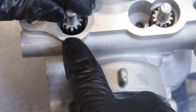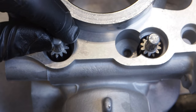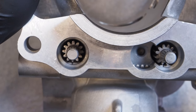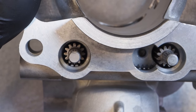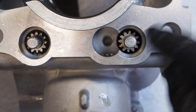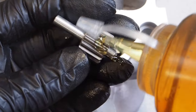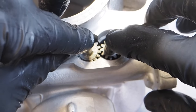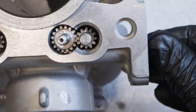This is where it gets a little tricky. Look down into the cylinder onto the operating rod for the timing line and line up the short pin with that timing line — do the same on the right side as well. You can see how I'm rotating the operating rod: you'll see the teeth and then the full timing line. The timing line needs to match up with the short gear pin on each valve. Next is the idler gear — it's important to make sure the short gear on the sub valve still lines up with the timing line in the operating rod. Don't forget to put two-stroke oil on those gears and the shaft. Hold your finger on the sub exhaust valve and slide the idler gear right in. As you turn the cylinder, the timing line on the operating rod should still line up with the short gear on the sub exhaust valve.